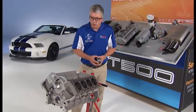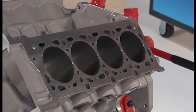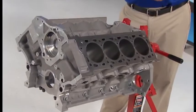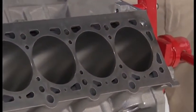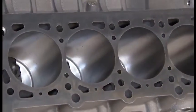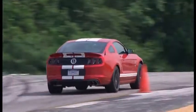So now let's take a look at our all aluminum block which is the heart and soul of generating the 662 horsepower that the GT500 makes. The bore diameter was increased to 93.5 millimeters. The plasma transfer wire arc technology that we used with this aluminum block is key to delivering a very lightweight block while also providing the durability which is key for long engine life. We end up with a steel sprayed-in liner that is mechanically interlocked with the wall of the aluminum — it gives very good durability. The geometry of the cylinder is very true and straight, which allows us to use reduced tension on our piston rings in order to give high performance via reduced parasitic losses in the engine and also gives a side benefit of improved fuel economy.